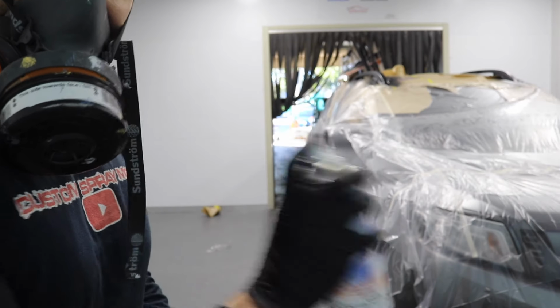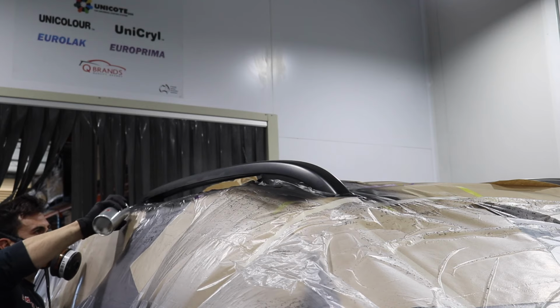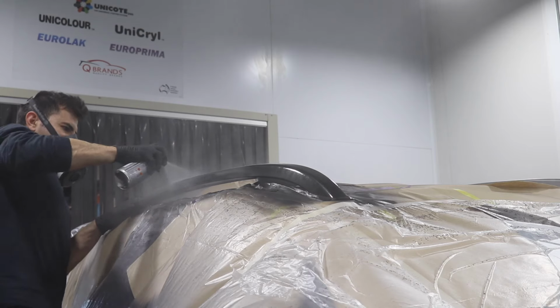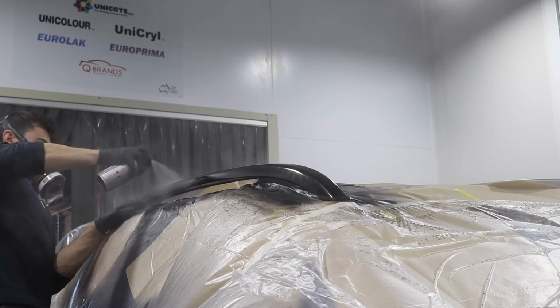I've got a full video using this clear that you can find in the description of this video, which goes over the clear in more detail. Now I'm going to spray 2 to 3 coats over the parts, waiting 10 minutes between coats, trying to get the top and sides nice and wet to get a nice, smooth, glossy finish.